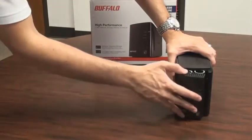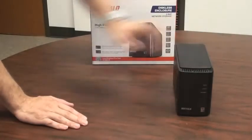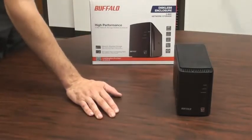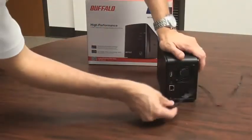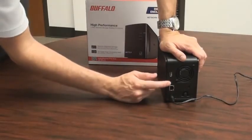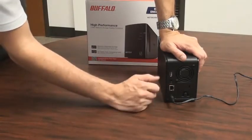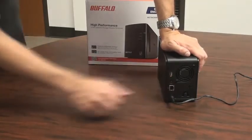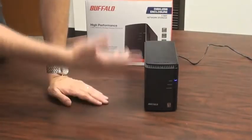At this point, I can put the front cover back on, which is done without tools — just gently flip it on. I've already plugged the power port into an AC adapter. Once you've done that, you can simply plug it into the back. Plug it right into the AC power port and you'll notice the on switch. There are three positions: off, on, and auto in that order. I generally recommend if you want it on all the time — and NAS devices usually should be on all the time — flip it to the middle position, which is on.